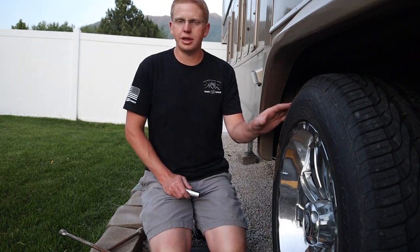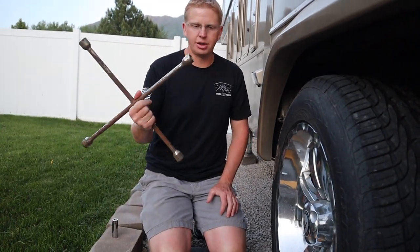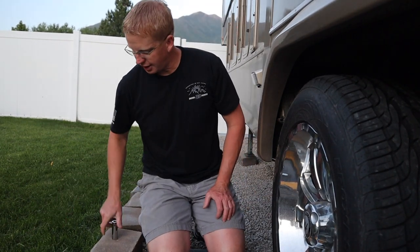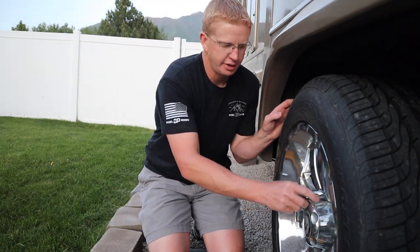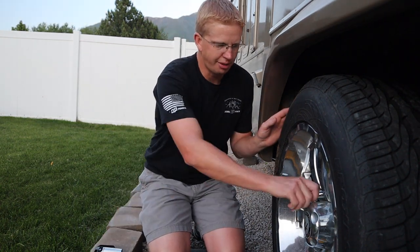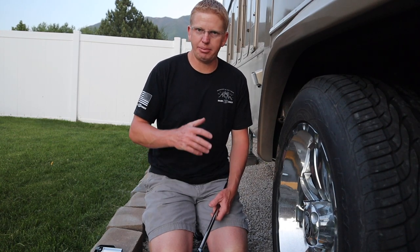Make sure you know what lug size you have. For this trailer it's three-quarter inch, and I have tons of star wrenches — like four or five of them — but the problem is they don't fit with these wheels. So I need a thin-walled socket to actually fit on these lugs. I like to throw in my battery-powered impact gun before I go, but it's not powerful enough to really cinch down a set of lugs to the wheel.